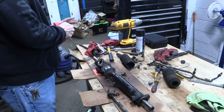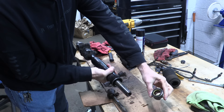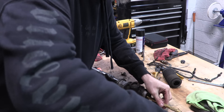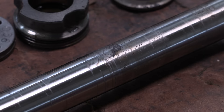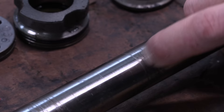It's typical just to find worn seals or busted lines, but if there is contamination of the power steering fluid — which does absorb humidity — then the internal parts could be rusty too. With the stopper gone, you can often remove the bushing just by pushing the steering rod in and back out again. You can then remove the steering gear shaft. It only comes out from the hydraulic cylinder end, not the gear end, but this poses challenges during reassembly because you'd have to scrape those sharp gear teeth across all your brand-new seals. I'm using a brass punch to tap it out because I didn't remove the spring-loaded rack support yet. Sadly, the shaft is corroded from moisture contamination as well as damage from being run dry. The deep rusty pitting means I need a new steering shaft.